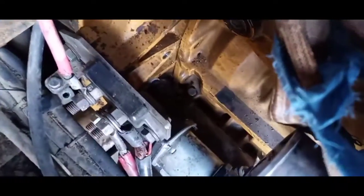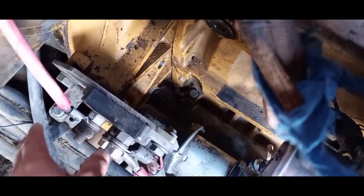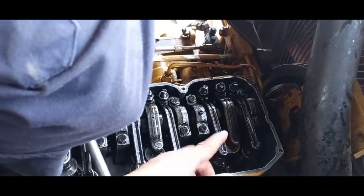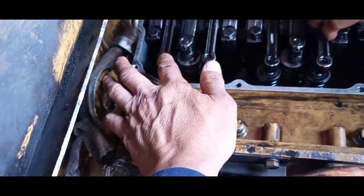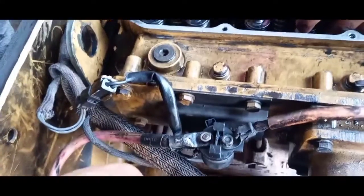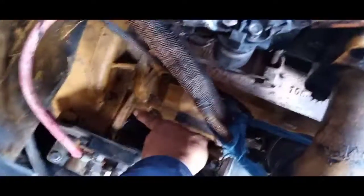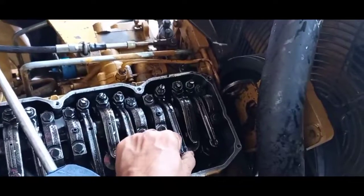...number six is at top dead center — properly at the top dead center position. You should put something up there — you can see this hole. This is the exact procedure. Number one is at the front of the engine and number six is at the rear of the engine, near the flywheel side.